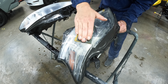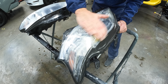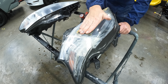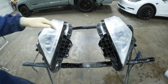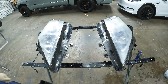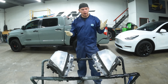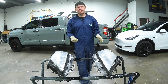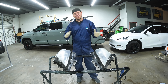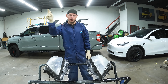These aren't too terrible just because they've been color sanded and buffed every so often, but essentially all the steps remain the same. If you can get any brackets out of the way it's going to be a lot easier and turn out a lot cleaner — that's all for prep. And obviously if you take off your headlights it's a lot easier and it's going to turn out a lot better. But if you do leave them on the car, make sure you mask it off well so you're not getting any overspray from the clear coat on your panels. Let's throw them in the spray booth.